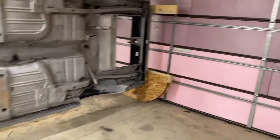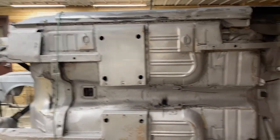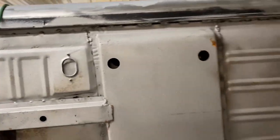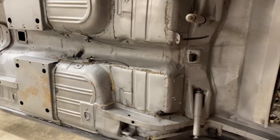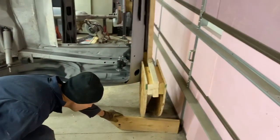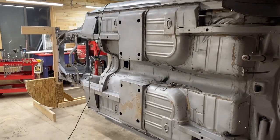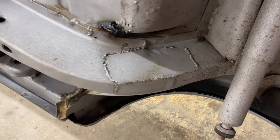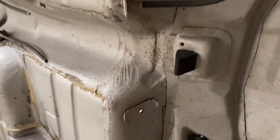There is the bottom of my car — she is belly facing us. This is going to be so much easier to work on. This is the first I've really seen this. I can see how the body floor pan was attached; I think that can be cleaned up and welded a little better. Obviously there's parking brake — or actually that might be brake lines — to work on, they just got cut off. Looks like there was a patch to the rear frame rail; I'll have to do some investigating on that. Rear seat belt mounts. Thanks, Dale — he did all the hard work. I am happy with that. Three thumbs up.